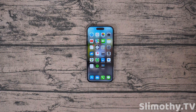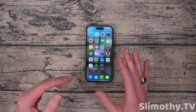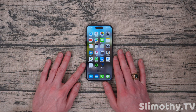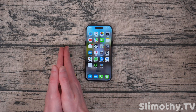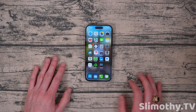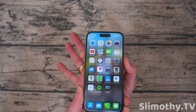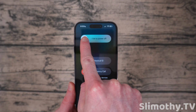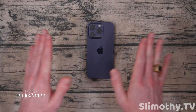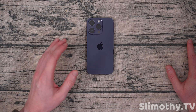I've seen so many people have issues after a big iOS update saying the update was horrible, it broke all my apps, location's broken. All they have to do is restart the phone after the update, which seems counterintuitive — you'd think everything should be working, but that's not how electronics work. So to reiterate: do the iOS update, your phone comes back up, use it as normal — check Facebook, check email — for about five or ten minutes, or just let it sit unlocked. Then do a normal reboot: hold volume up and power, hold it, and slide to power off. Wait three to five minutes, then boot it back up. You should have no issues after the update — it should eliminate almost all bugs that the update caused.